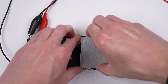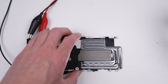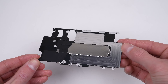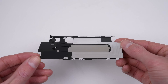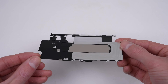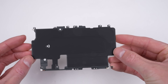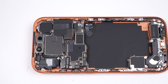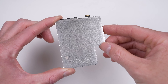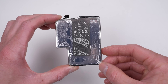Once it had reached 0.1 of a volt, the battery's adhesive had deactivated and the battery could be just lifted free, leaving us with an uninterrupted look at the vapor chamber. The vapor chamber doesn't directly attach to the CPU with any kind of thermal paste, which is odd. There is a black pad, although it doesn't look like any thermal pad I've seen before. The CPU is also hidden behind more graphite, so it seems like the battery would be making better thermal contact with it than the CPU is.